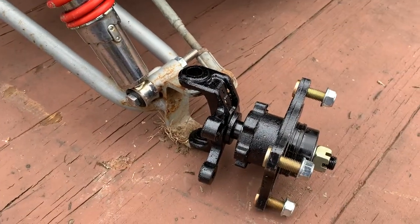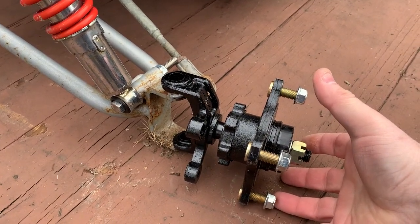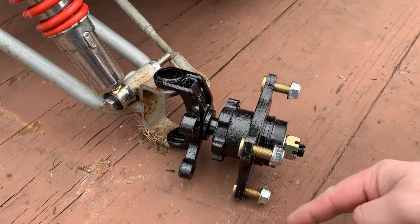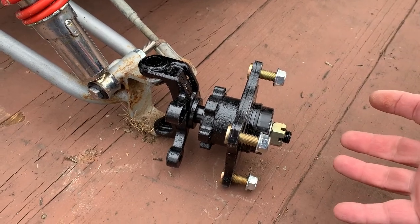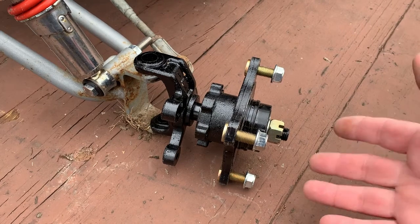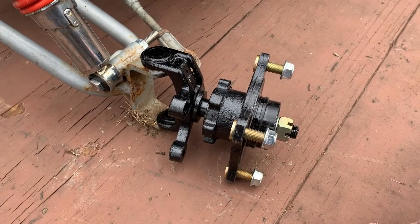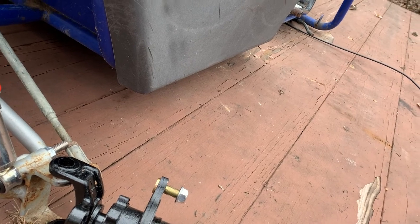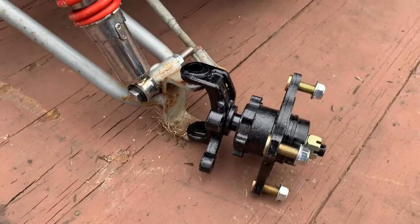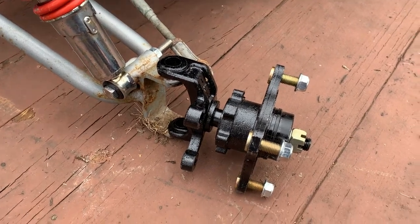This is just to illustrate it. Your wheel hub — if you have one, which you wouldn't in the front normally — but I'm making an adapter here, because my wheels are a 5.5-inch bolt pattern and you can't buy 5.5-inch bolt pattern. I've looked everywhere. They're 4 inch — 110 millimeter to be exact, which is like 4.3 inch. The rear, I found 5 and 3/8ths out of all sizes. I'm like, what in the heck? But that's what I found. If anybody knows where you can get 5.5-inch, please let me know — just put it in the comments.